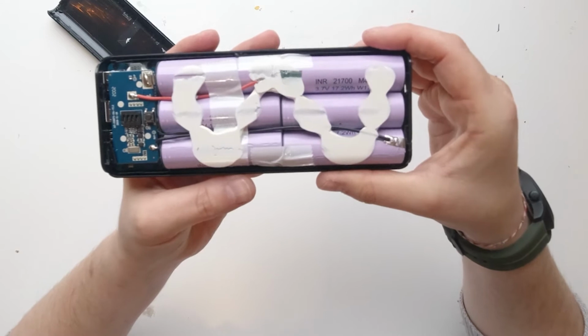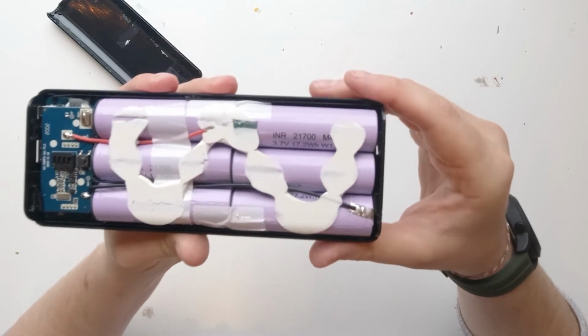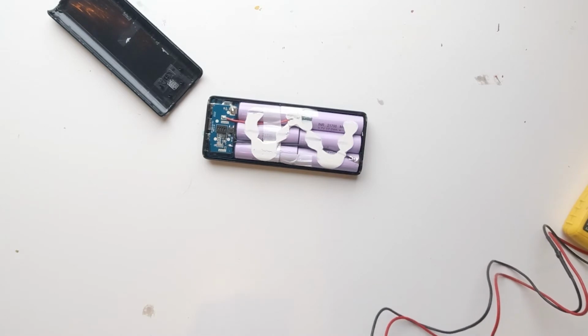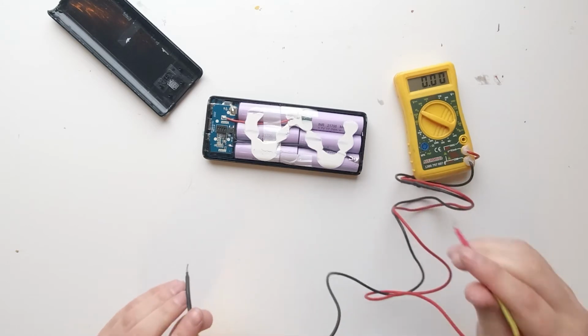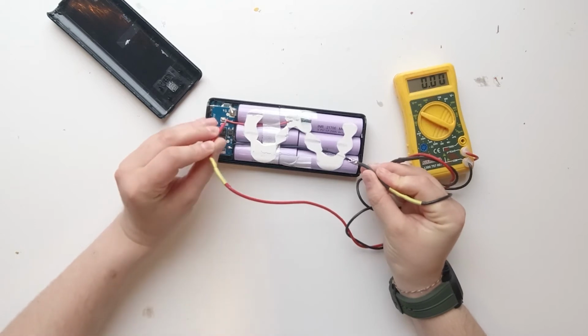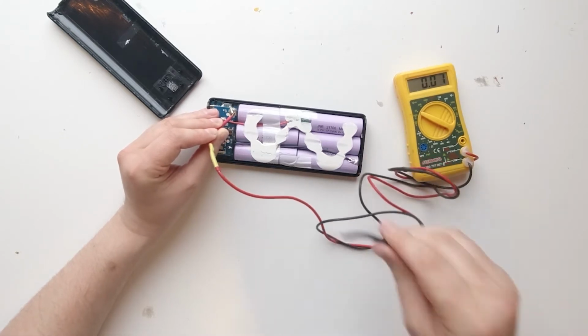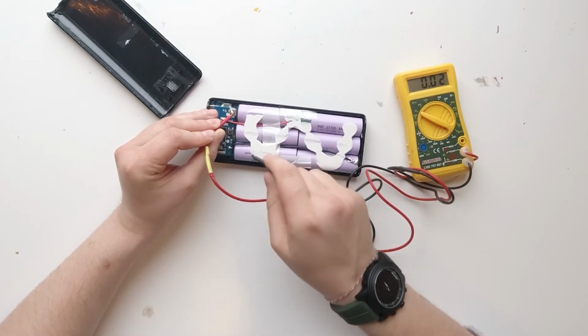Some power banks can put out 5 volts, which is the normal, and it has been for quite a few years now, and that will power things like phones and iPads. But some devices now, like iPads, can also charge at 9 volts and 5 volts, and with a total of 20 watts of power going in. But this power bank can produce 20 volts at 1.5 amps, meaning it can actually power a MacBook Pro. Typically, a laptop or a MacBook Pro can charge from 15 volts or 20 volts, but that means there's some tech wizardry going on inside here.